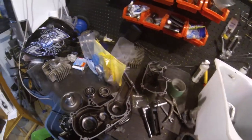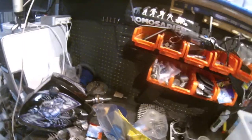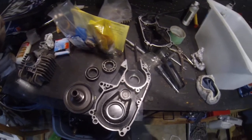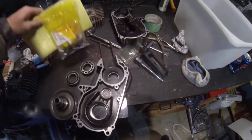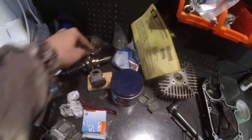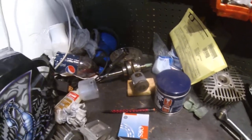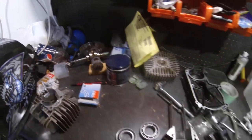Doing a little more work down here — finally time to rebuild the red bike engine from the Tomos video I posted earlier. Everything's kind of in the box and out on the bench. I got bearings today, seals today. The crank has a little pin taped down, and I didn't feel like replacing the circlips because I don't have any, so I carefully disassembled while keeping the piston and ring intact.